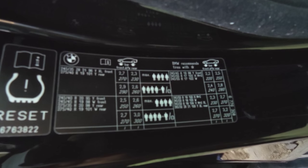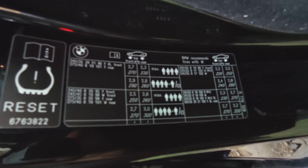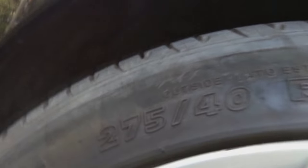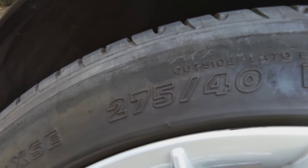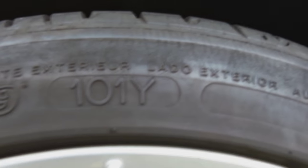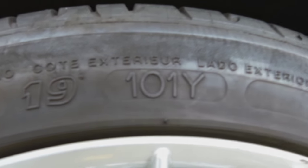In the case of my car, it has got several options for different tire types. The first thing to do is go and determine which tire you have. Walk to your tire with a pen and paper handy. It says 275, 40, 19 inch, and that number there is the weight rating followed by the speed rating. So in my case it's a 275, 40, 19, 101 Y.